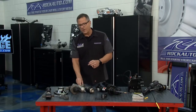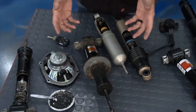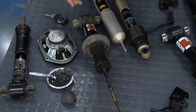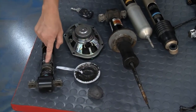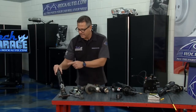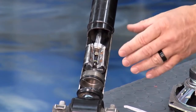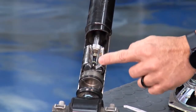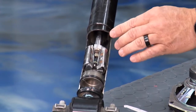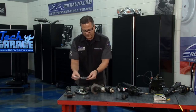Speaking of going really fast, let's look at our Magna Ride system — our magneto-rheological ride. This is the one that Brian took off the front of the car. You can see it leaked out all the fluid. That big old blob is what was left in there once all the oil was out. Now look inside — you've got the wires feeding down to these magnets. We energize it or de-energize it. We energize it, and we make the fluid real thick, real viscous — it's harder to go through these chambers and it makes the ride very stiff. If I take the magnetism away from it, the fluid becomes real thin and it flows through easily so you get more of a bounce. What's in there? It's called MR fluid. Brian called it my makeup — I have some right here.